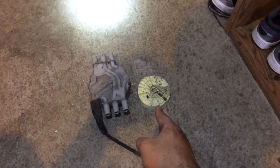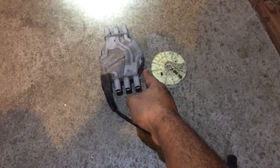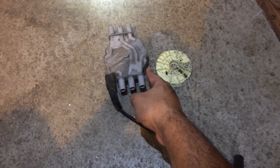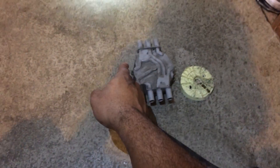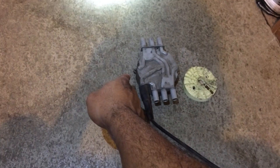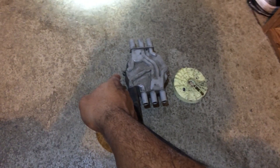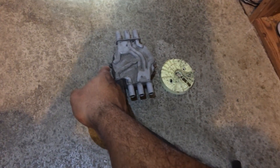That's the old rotor right there — you can see it's all worn out. There is only a screw right here on this side, which is a T15 Torx. Then right directly behind that, on the back, is another T15 Torx — this one is kind of hard to get to. This back screw you'll have to do blindly, so just take your time so you don't drop the screw down into your engine.